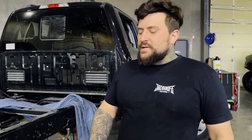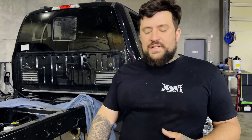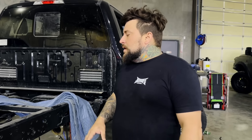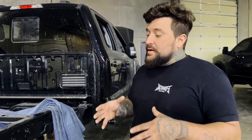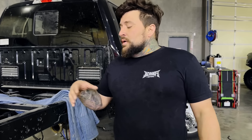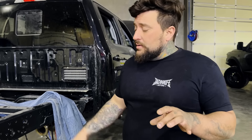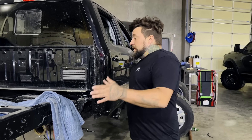What that's going to give us is a pass-through axle, and it gives us the same parts as far as hubs and brakes go. If we need to service it in the future, we can use all the same part numbers for all four of our rear brake or hub assemblies. It'll be a bit of work because we're going to have to design the Rockwell center section into new round axle tubes — the Rockwell uses square axle tubes — so the plate structure is going to get a little wild. We'll also need custom axle shafts made for the pass-through axle. So we're heading to Boyce Equipment in Ogden right now to find that Rockwell center section.